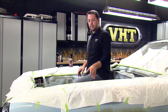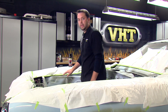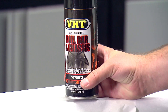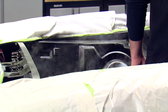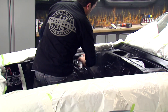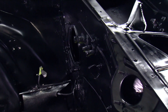We've taken care of our rust, sanded the engine bay, and used our VHT self-etch primer on any bare metal areas. We also completed the taping, including taping off the AC and cooling areas and any areas where we don't want the top coat paint to show. Now that we're properly prepped and scuffed, we're ready to paint the engine bay with our roll bar and chassis paint. This is a self-priming formula — apply two to three light coats first with about 10 minutes between coats, making sure all coats are down within one hour. I laid down three coats total — two light coats followed by one medium coat — and went through about two cans of VHT roll bar and chassis paint. The gloss black looks great and is also protected from chemicals, rust, and corrosion. We're going to let it dry about 24 hours and then work on putting our engine back in.